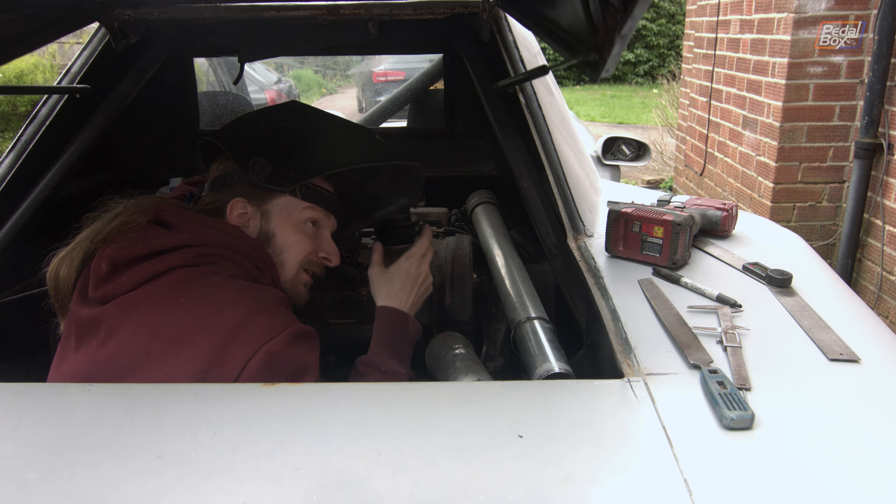I'm going to sit here in the engine bay, clip this into our latch up at the top, bring it down, and wherever this ends up sitting inside the bay I'm going to weld it up in place. We'll need to adjust the height offset — move the two nuts up and down to set the clamping position — but we'll figure that out once it's closed. That's tacked in place now; it's a weak tack because I could only get to one little corner, but it's in the right spot — it unclipped when the engine bay was opened so I think we're good. We wound the ball out to avoid damaging it with the weld, then put a big fat seam down the outboard edge. We closed it and sure enough it has latched — the button in the middle has come up, it's all locked in place. Press the button while lifting and we're away. I'll call that a win.